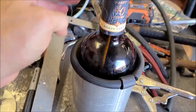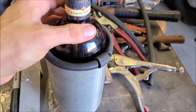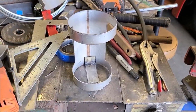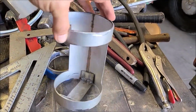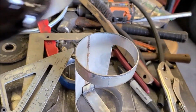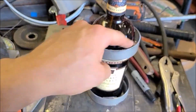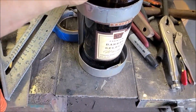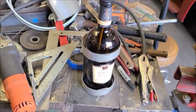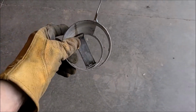And then we've got the rubber along the top here, which I'll attach with some weather cement. I ended up putting a little thicker piece here because it was still just a hair loose, so I think that'll work well. Got the window part of it notched out, so that'll give me plenty to weld as an attachment back there. And then this just fits right in there like that. And then I'll put the rubber around here once it's all painted again, and that ought to give it a nice, I think anyway, a nice tight spot to sit. That's what I've ended up with for that bracket.